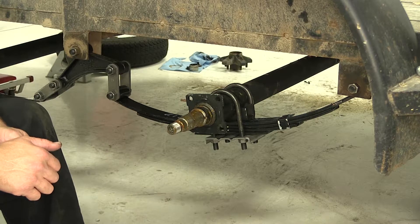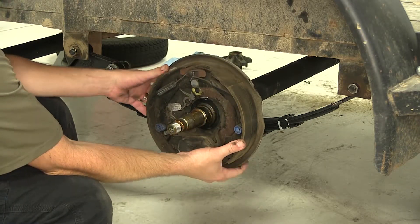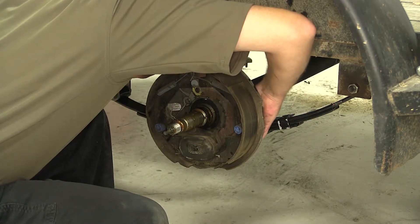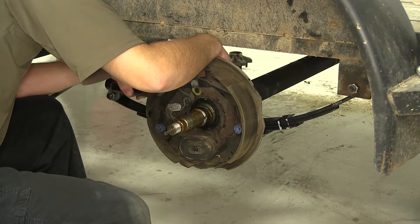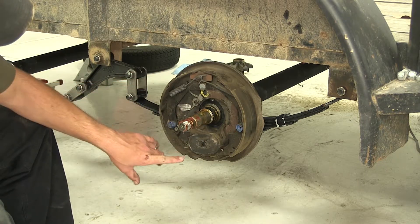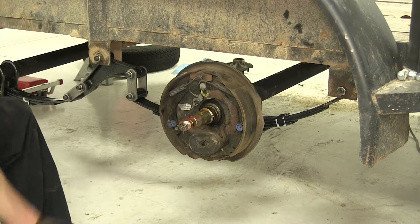Now our front axle is our braking axle for this application. Whether you're installing a new brake drum assembly or reusing an old one, it'll install the same way. We'll line the studs on the backing plate up with the axle, then install a split lock washer and nut to secure it. It will make a difference for driver or passenger side — as you can see here, it's labeled for right passenger side. Another way to double check is to look at the shoe length: the larger shoe will be towards the rear of the trailer and does the majority of the braking.